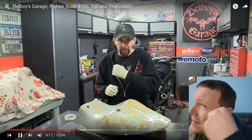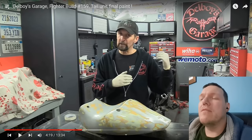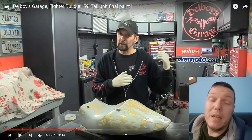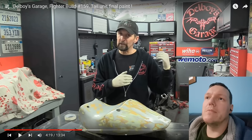Super fine finish when you come to paint. You need that with satin and matte paints because you cannot correct them or buff or polish them afterwards. How they come out of the gun or... But he seems to think that the reason why you polish these things or whatever is just because, oh, it's imperfections. No, what we can see in yours is surface imperfections, i.e. pinholes, chasms, pinholes and debris and shit falling into the paint. That's got nothing to do with what paper you use. That's to do with piss-poor preparation and piss-poor practices when you're doing it.